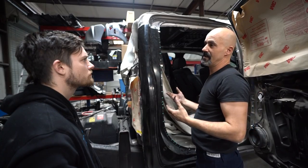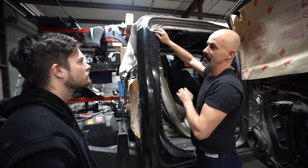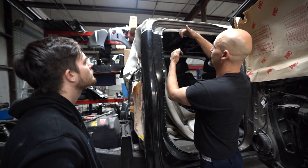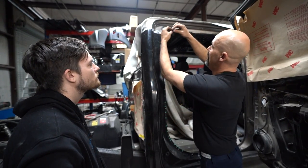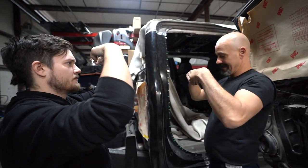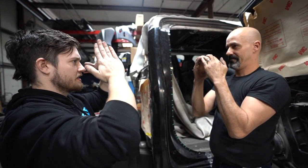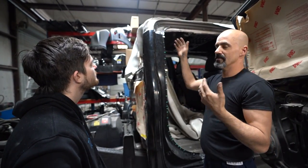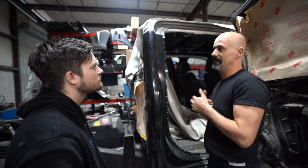No, absolutely not. You want a 1.5 millimeter root gap so that when you weld to your sleeve, you're striking the arc on the sleeve and then burning into the panels on both sides, basically filling the gap with weld and connecting the bottom to the sides. That's the idea. But if you do have a little miscut, it's not the end of the world.